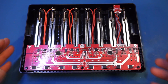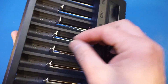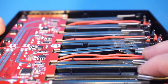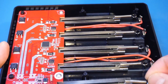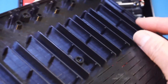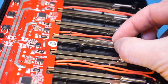I'll need to remove some screws, but first let's look at the mechanism for the battery holder. You can see these are the battery holders — if I move this, you can see it is making contact with these tabs at the bottom. You can move this, and here is the spring that I can put in place. This is how the mechanism works, and the tabs are held in by the molding on the other side of the cover, essentially used to hold in the tab while you're sliding the contact. Pretty neat.